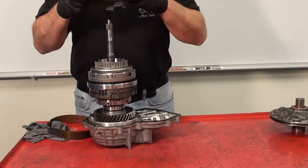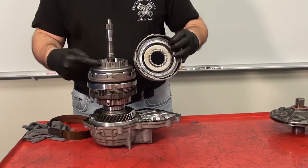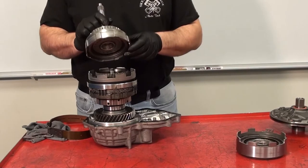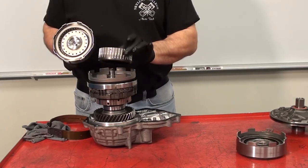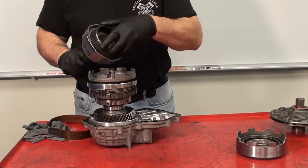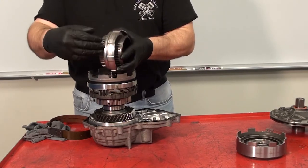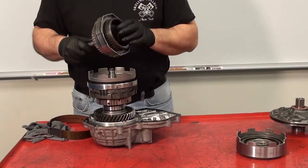The direct clutch pulls off and inside is a clutch pack that is splined onto the input shaft. Pulling up on the input shaft reveals the forward clutch assembly. We now discover the front ring gear that is splined and fitted into the forward clutch. When fluid pressure comes into the forward clutch, it locks the front ring gear to the input shaft and they will turn together as one unit.